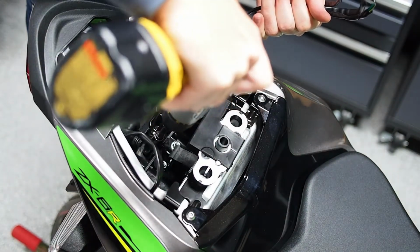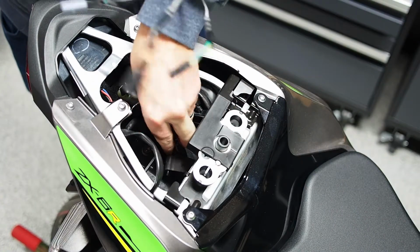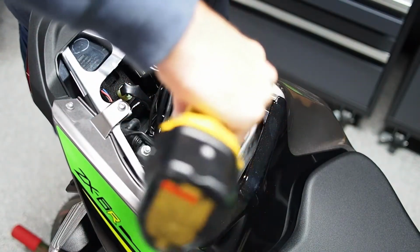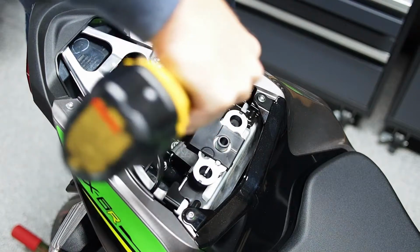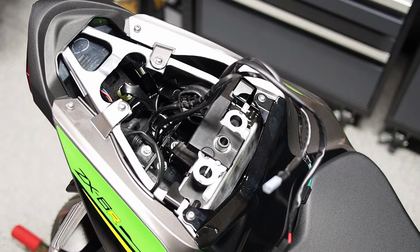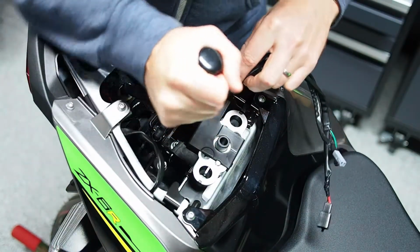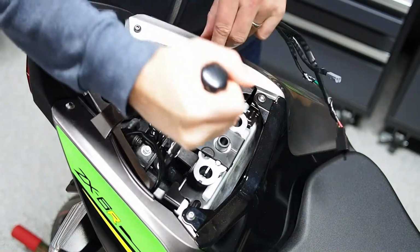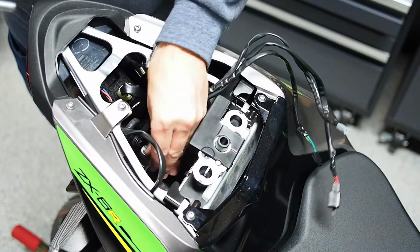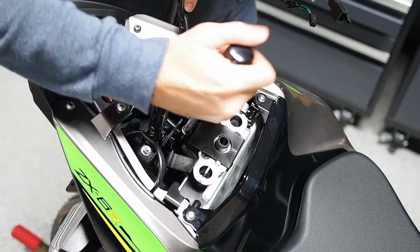So just tighten them all a little bit. These are locking nuts, so you don't have to go crazy tight because you still are sandwiching through some pieces of plastic. At that point, I would always recommend you step away from a power driver and just check with your hand. These need to be essentially hand tight. You'll feel the lock washer portion of the locking nut bottom out, and that's essentially as tight as you need it to get. So your bolts are tight.